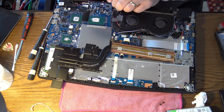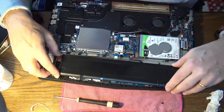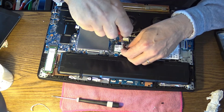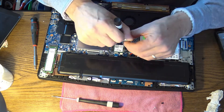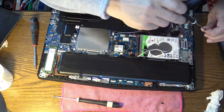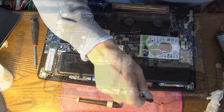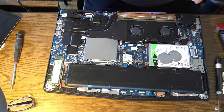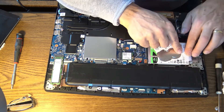It's a bit of a mess but nice and easy — you can put everything back together. Let's have the battery back in place. Don't make any connections until the screws are in and fixing everything. The hard drive and WiFi are in place, the antennas are set. Don't forget to check the display connector on the other side of the motherboard — it happened to me once to forget it and nothing would start. I panicked a little.